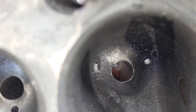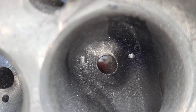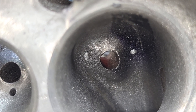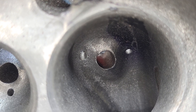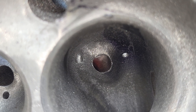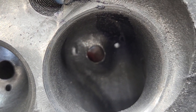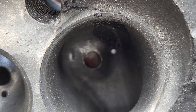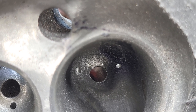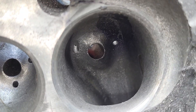There's no way I'm going to ruin the heads I've already put 100-plus hours into. But I did re-engineer the bowls according to the roof heights, and when I get a chance to reflow those, I think it'll help — it'll definitely help in the higher lift ranges. I'll get the full game plan from DV when I get to North Carolina. They wanted to run those open chamber heads with the iron manifolds and iron intake manifold. I have an iron throttle body intake manifold and an iron single plane intake manifold, all of which have been ported out — those are all done and ready to go.